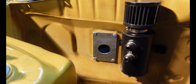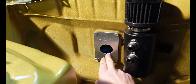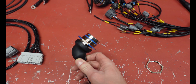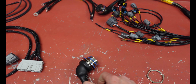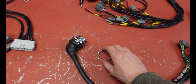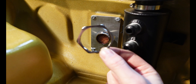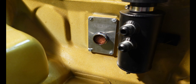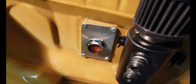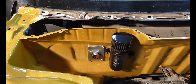I'm going to run the harness inside the car and attach it to this plate. The ECU side of the harness is going to attach to the plate — this plug here gets tightened with this nut right here, so it just gets threaded on. I got the harness pushed through the plate from inside the car. Now it's just a matter of tightening it up with this nut. That looks sick — mounting this is basically done.